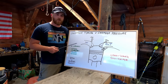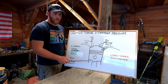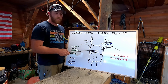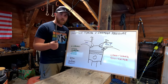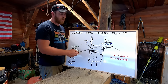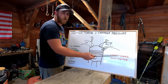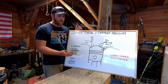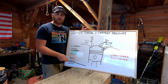The two main variables we have to account for when timing the spark plug are engine RPM and mixture density. As the engine spins faster, we have to advance our timing so the mixture reaches peak chamber pressure just after top dead center. Mixture density relates to how lean or rich our mixture is — a lean mixture burns slower and a rich mixture burns faster. We have to account for both to get the most power out of our engine.